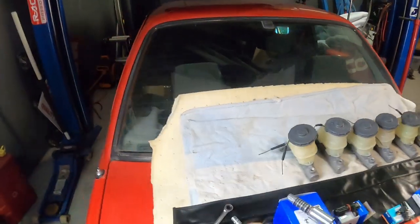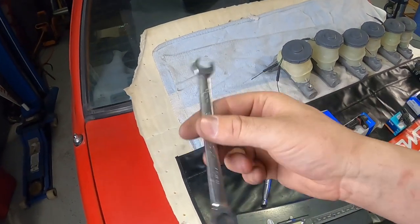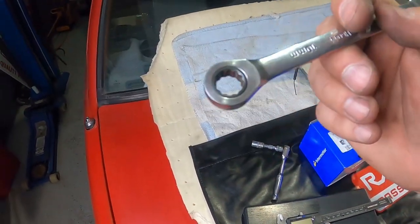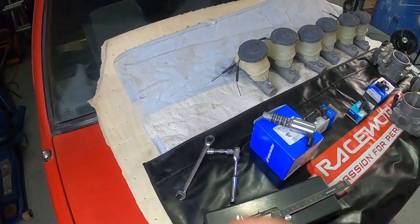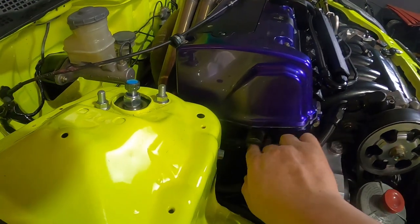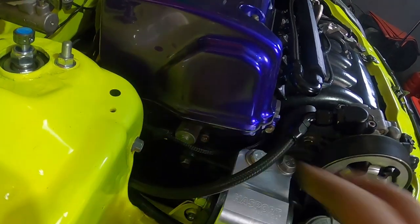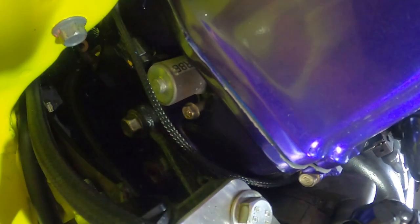The tools you're going to need for this job are a 10 mil ratchet — the infamous 10 mil — and a 10 mil spanner; this one's got a ratchet on the end but depending on the space I might need a regular 10 mil spanner. We're going to get to this one first. What you need to do is undo this plug and then there is a 10 mil bolt just here — undo that, give it a wiggle, and pop it straight out.